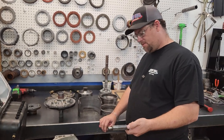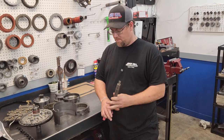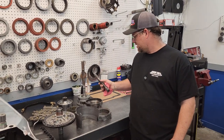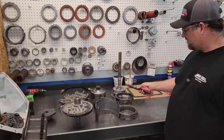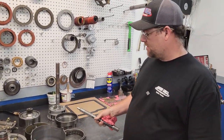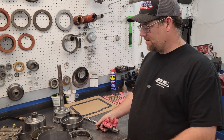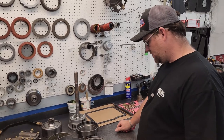How y'all doing guys. The main thing we found was a flipped ring — that's your converter charge pressure — it makes the converter charge pressure go all over the place. That caused it to chew the bushing up in the stator tube, and a lot of the clutches got hot. The brass washer that goes inside the bottom of the planetary was all chewed up. The input should have had some brass material in there. The band and clutches mainly just got hot spots — they definitely need to be changed, but not necessarily causing a problem. So we'll put it together.